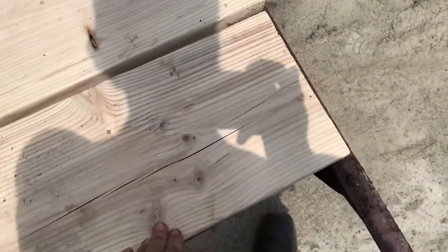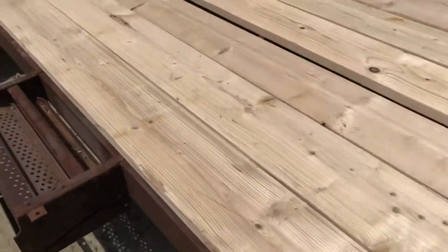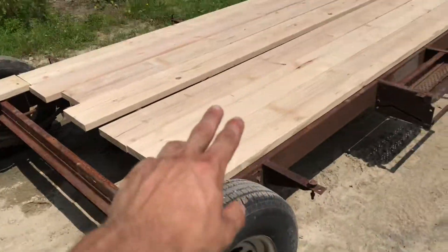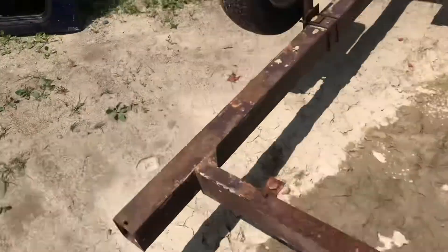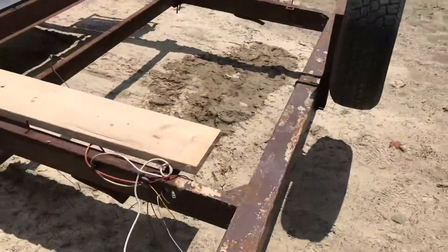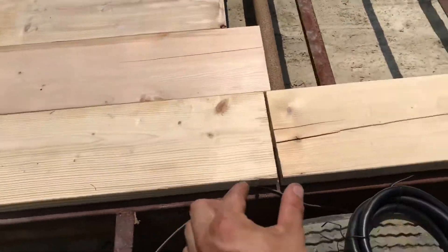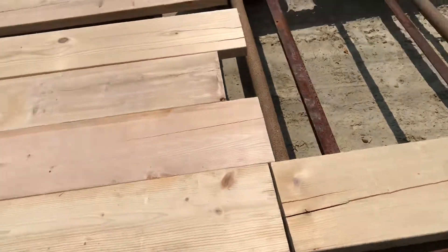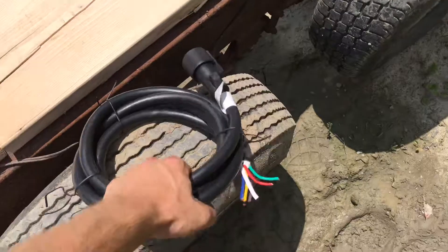This one's twisted, some are split all the way down, some have splits, and some are chewed up. I still have to take the tank out — there's another tank under here too. I got eight boards but I'm going to need about ten more, sixteen total. I'm going to make a 24-foot trailer, and in the center I'll put a four-inch wide square tube right underneath so I can put plate on top and screw it down, then individually pull each crossmember.